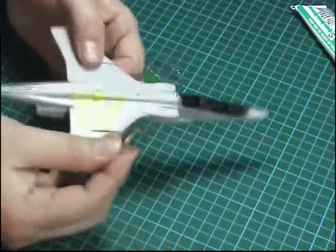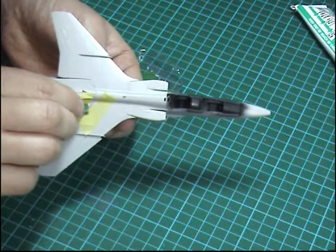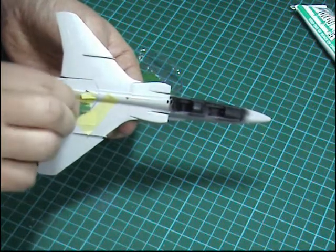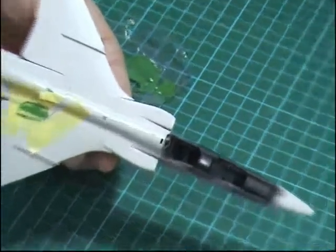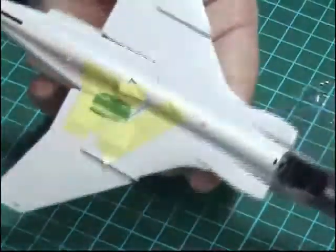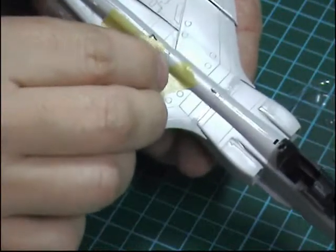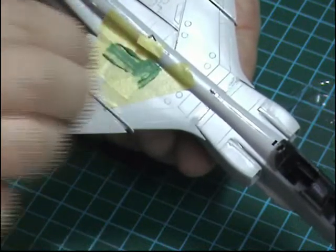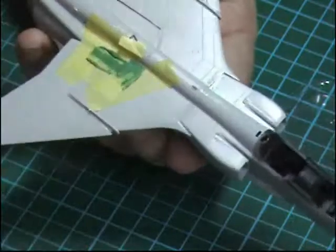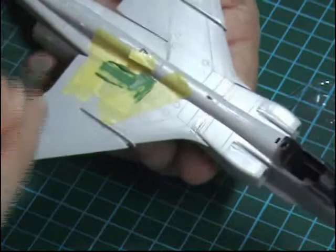Okay then, all you do, scoop a bit up on your spatula, and then just go along and push it into that panel, like so. I'll perhaps bring you in a little bit closer. So we pulled it in like that, and obviously we've still got quite a bit on there, so we're just going to do in there too. Now don't be going in there dragging to get it perfectly smooth, because don't forget, this will shrink back. This will probably need, in most cases, two coats.